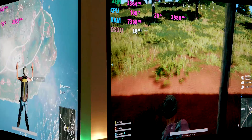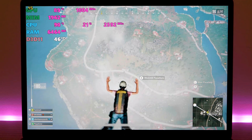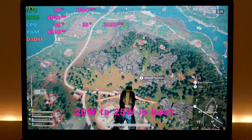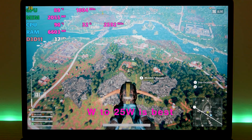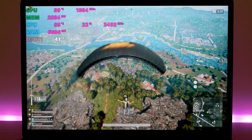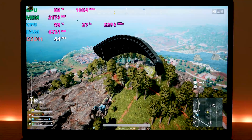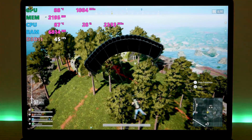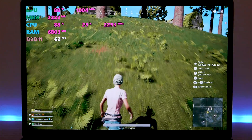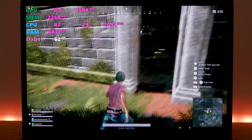I'll go to XTU. So now I have limited the wattage to 15 watts on the CPU. And now you can see the clock speed is much lower — it was like 3.8GHz, now it's like 1.8–2.2GHz. You might think, oh that's no good — I've limited the wattage and the frequency is a lot lower than it was. But it actually works out much better. We're not going to get those fluctuations. Look — I'm hitting 60 frames per second. I have not changed the settings at all.